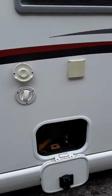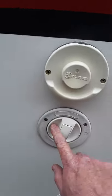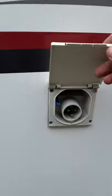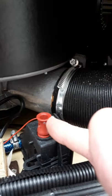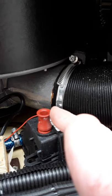Now on the left-hand side of the van — this is your fresh water fill here, this is the exhaust for the heater, and that is your mains plug-in. Down here in this little compartment you can see the heater. What we're looking at here is the frost valve for the heater — this little red button. At the moment it's up, which is the closed position, and that's the way it should be for normal operation of your water inside the van.